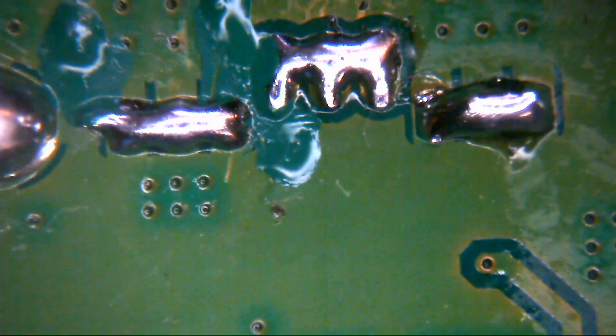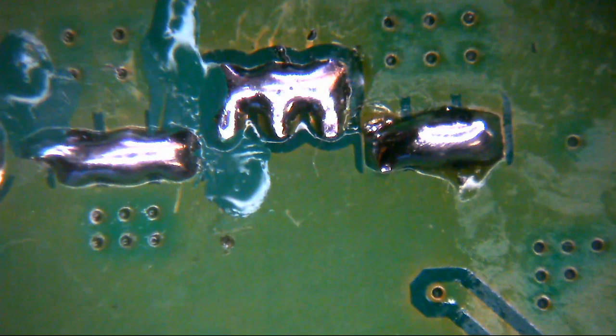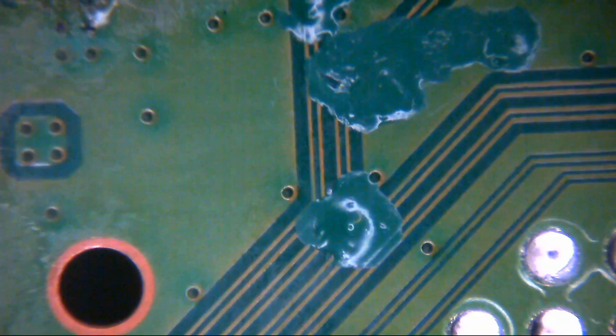Right, okay. So, as we were mentioning, here we go then. Everything here looks okay. Ground, power, ground, okay. We've insulated those nicks in the solder mask. Then down to the actual traces themselves for the SATA bus. Here we go. So that's the bit we had to scratch back to verify continuity across that break there.